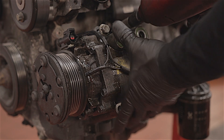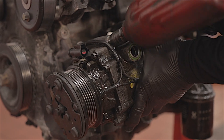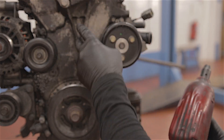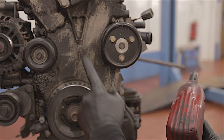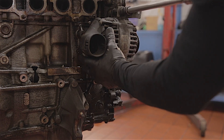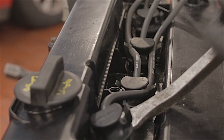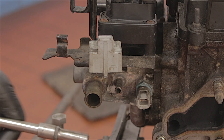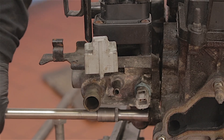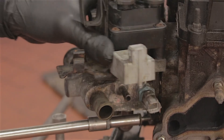There — four 13mm bolts on your aircon pump. I'm going to remove the cylinder head, but I'm going to have to get the chain and chain cover all off as well, so all these pulleys have got to come off. And last but not least, the alternator. Spark plug leads, off you come. There's a little water housing at the end of the cylinder head — I haven't got to take this off, it's four light 8mms, but I'm going to unbolt it anyway just to get it out of the way. That holds the coil pack on top.